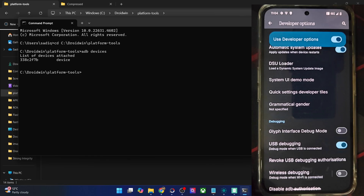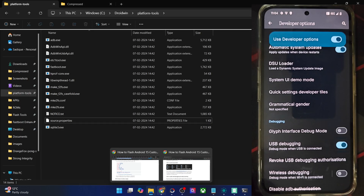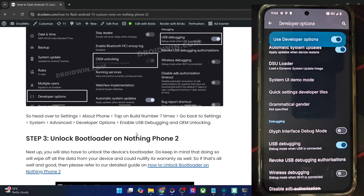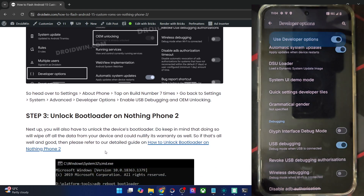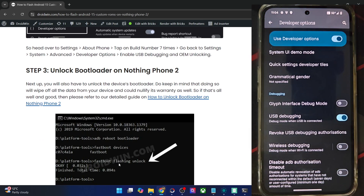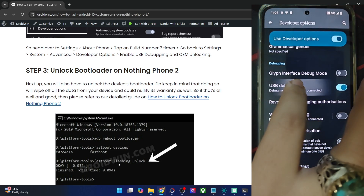Once you are getting this ID, your next course of action is to unlock the bootloader on your phone. Do note that unlocking will wipe off all the data and it might make the warranty null and void as well. If that's well and good, you could refer to a guide and get this job done. Just boot your phone to fastboot mode and use the 'fastboot flashing unlock' command. You will get a prompt on your phone — use the volume key to highlight 'Unlock the Bootloader' and press the power key to confirm. The bootloader will be unlocked, your phone will undergo a wipe, and then go to the OS. Once it's in the OS, make sure to re-enable USB debugging.